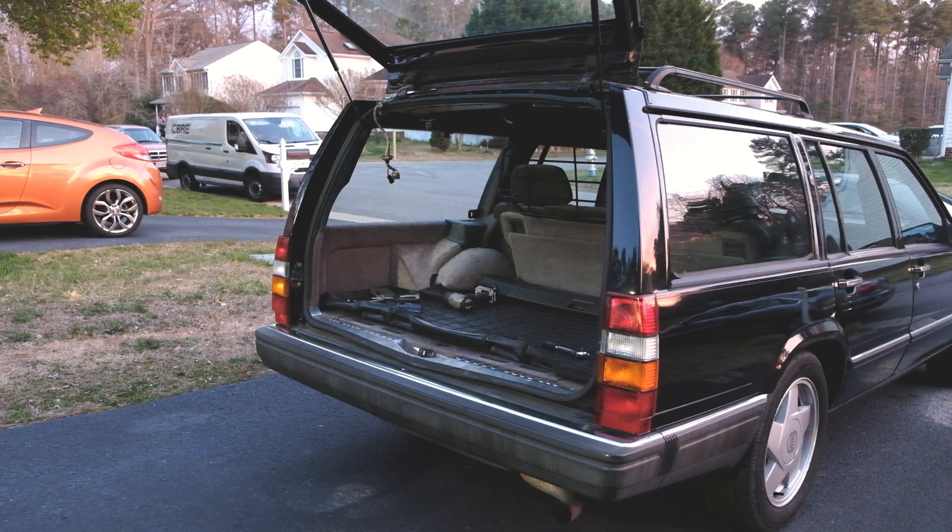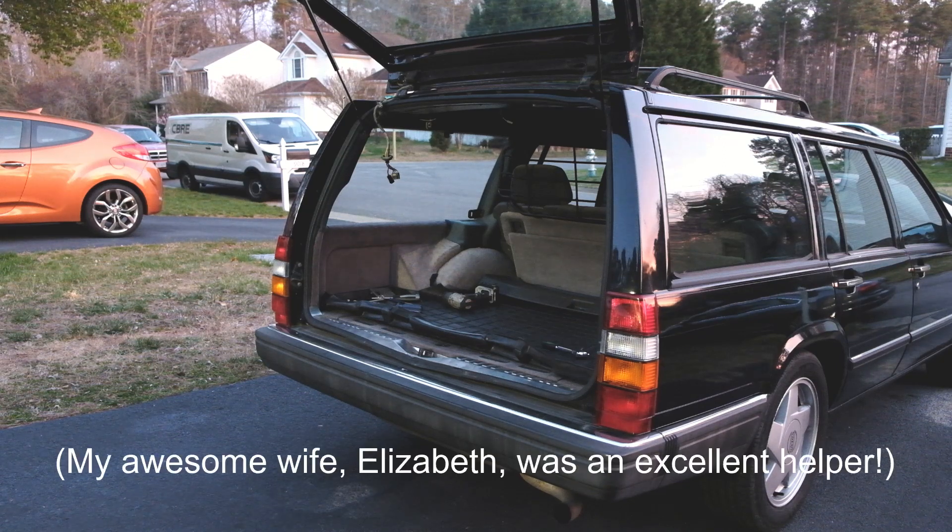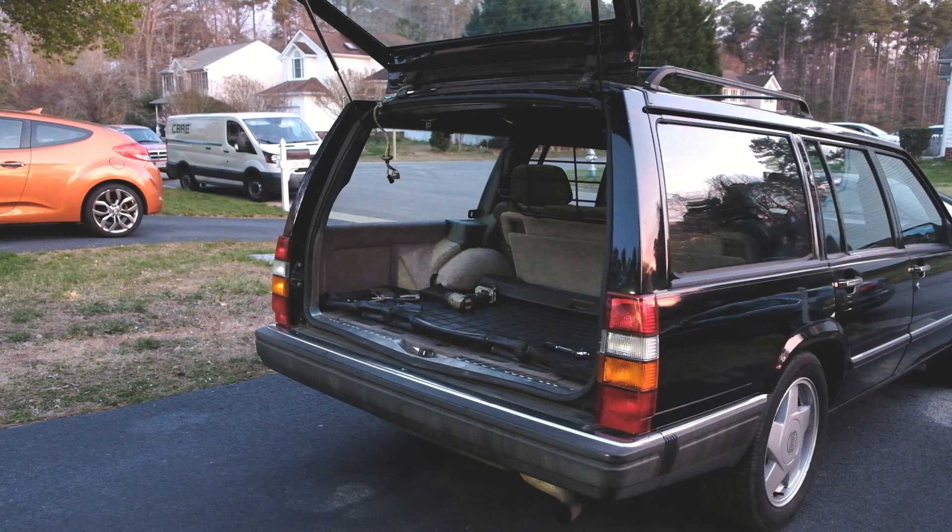The new one is in place but not totally fastened. My pro tips: don't mess with the stabilizer struts until you have the first two bolts in, because getting the flanges lined up from the actual hinges can be a little tricky. You definitely need a helper — I never could have done this by myself. The hinges have a little plate that the bolts go through, and those pivot, so you have to get those lined up with a screwdriver and then thread the bolts in from inside the car. Put all four bolts in, put your wiring harness back through, do every removal step in reverse order, and you are all done.